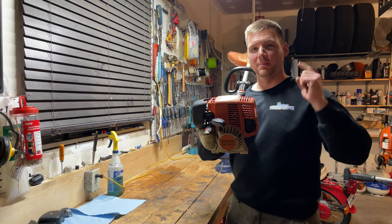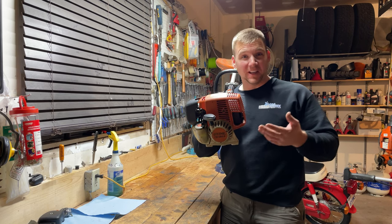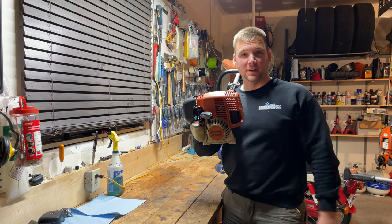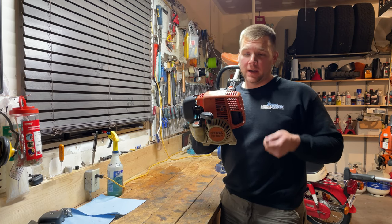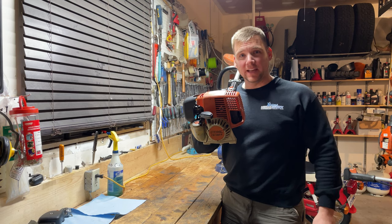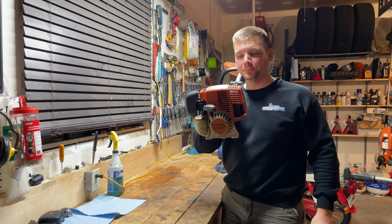Thanks for watching the video, guys. Much appreciated. Hope I got to help somebody out there in YouTube land. It's really not that hard, as you can see, to do that valve adjustment. And as a homeowner, you probably want to look at doing it once a year and at least use your feeler gauge and make that check. But really, once you're in there, it's not that hard to make that fine adjustment with that 8 mil.